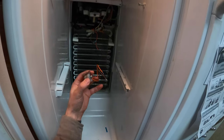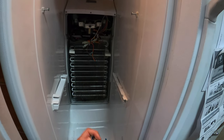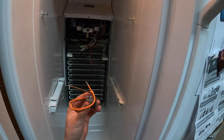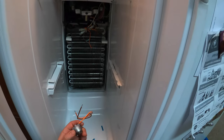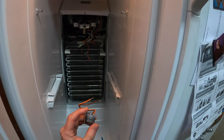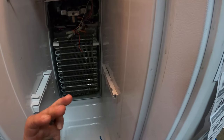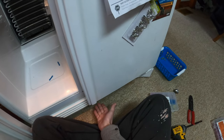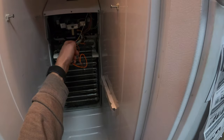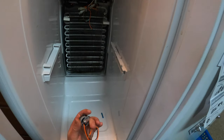Okay, let's get to fixing this. So I got a brand new defrost termination switch. Once these coils warm up, this defrost termination switch turns the heater off, which is down at the bottom. And then once the coils cool back down — I think that's supposed to be 33 degrees — it will kick the switch back on. However, because the defrost timer should be off at that point, it will then turn the fan on instead. So this switch controls both the fan and the heater coils.